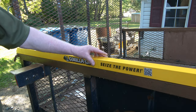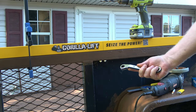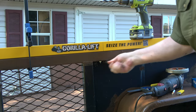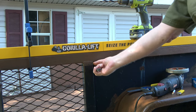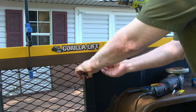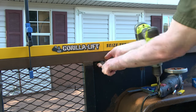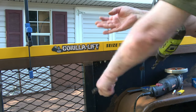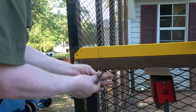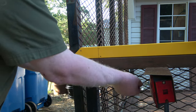When you bolt this down, line these up nice and flush so the spring doesn't bind up — half inch wrench. Not superman tight, just snug. You can tighten them later, a year from now. I noticed in the back when I was tightening down, that bolt was squishing the square tubing, so don't go super tight.